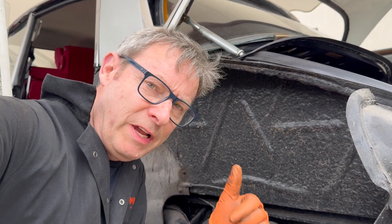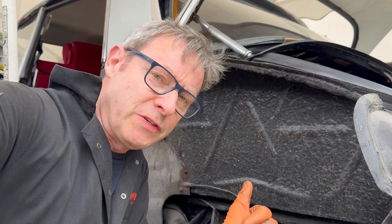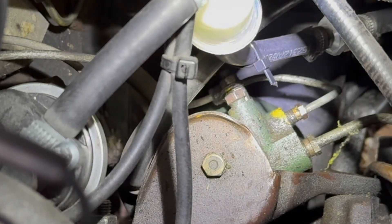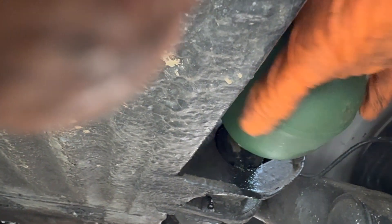This side is now loose. I'm going to put the wheel back on, get the trolley jack underneath the car but low, then put it on its low setting so it goes down and releases the pressure in the suspension. Then I've got to undo something at the front on the regulator or the accumulator, and then I've got to jack the back of the car back up and take these spheres off. The car's gone down with the jack underneath it. I've jacked the rear up. I've now got to loosen the bleed screw on the pressure regulator to remove all the pressure from the circuit. That's the pressure regulator bleed screw - looks like 12mm to me. Let's just crack that half a turn. This might be able to undo by hand now the pressure has been relieved. It's just a matter of screwing that off. This is the good one - it was the one that was causing me a problem.